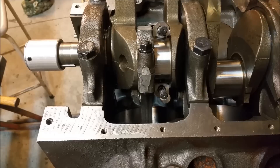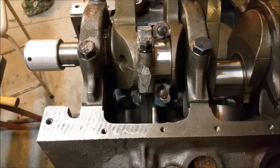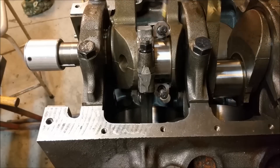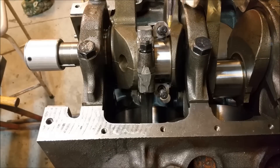I'll flip the engine upside down and have a look — this is the very reason I use bits of hose. You can see it's touching the crankshaft — no big deal at all — but if there was no protection I could really do a lot of damage to the crank. I'll push the rod up and pull those hose pieces off. Now it's all safe.